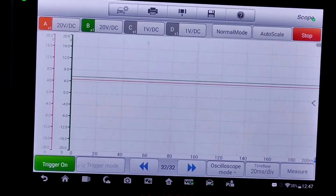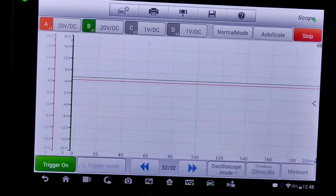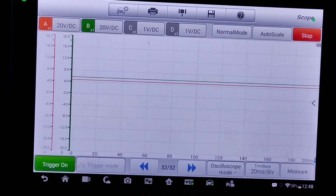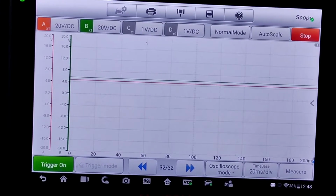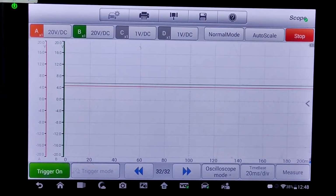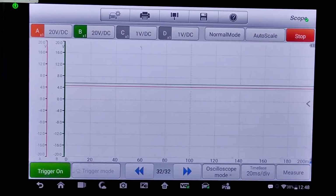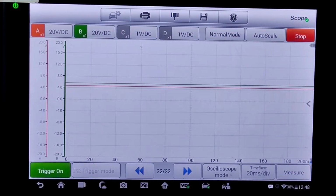I'm going to go to the crank sensor, move around here, and make sure our information on the green is not changing. Moving the wires around, moving the ground wire that's under the module. Nothing's changing. I'm going to go to the PCM around here, even though the issue didn't present itself until I went to the module. Move that around. I mean, just going everywhere, just moving things around. Nothing has changed. Going back to the module, moving the wires around.